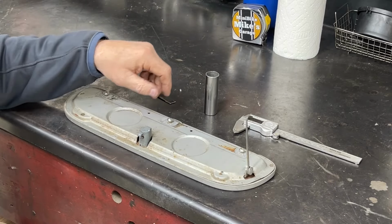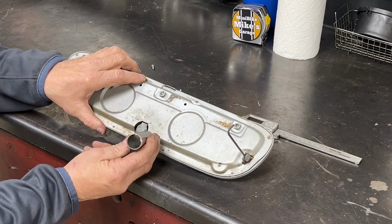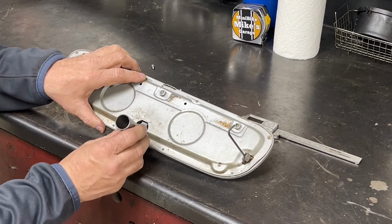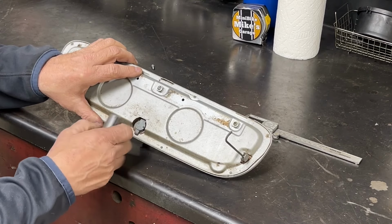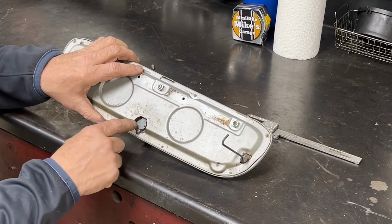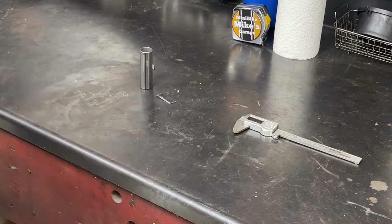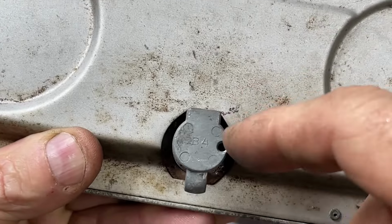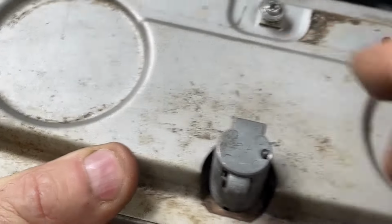And so I got looking at it. And this is the 1-inch OD, .063 wall round tube that I use for fixing exhaust on CT70s, that rotted spot. And it fit perfect in this little cutout of the sheet metal on the glove box door here. And it's big enough ID that it fits around the latch. Now, the latch itself has a couple spots here that you got to work around. It's not just perfectly round, it's got this little bump, and then you've got the catch itself that you have to work around. So